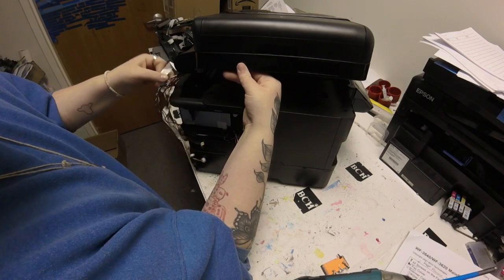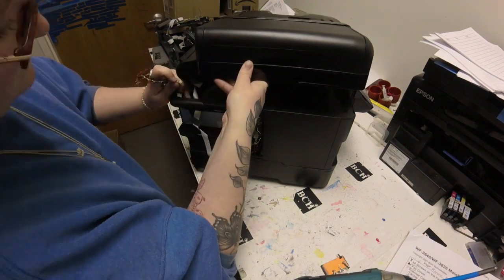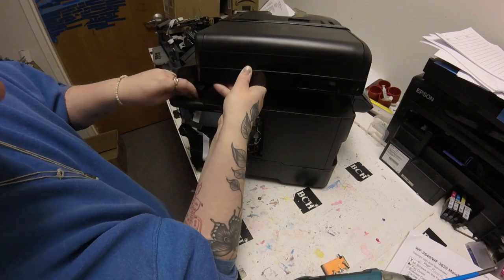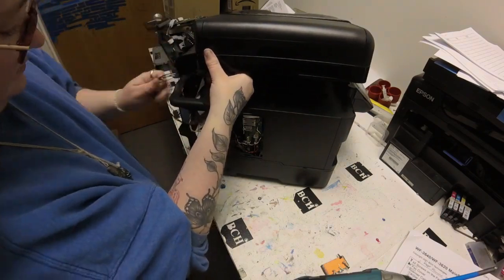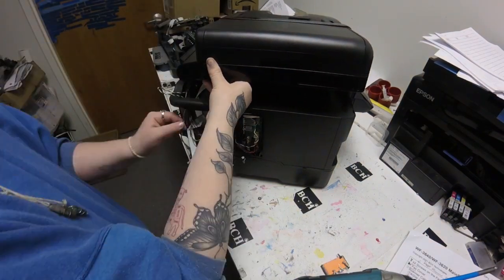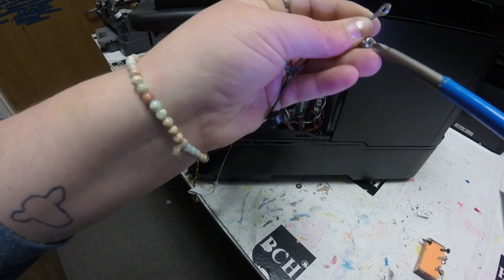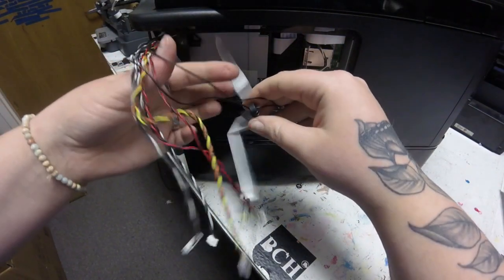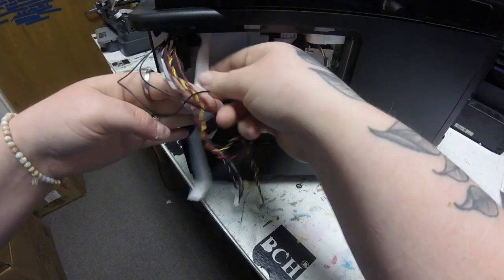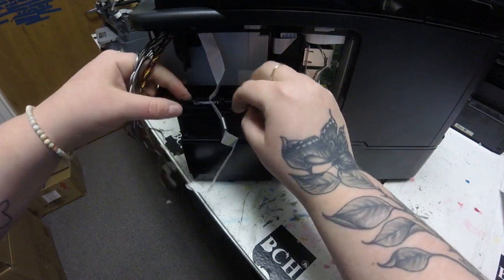Here I'm putting the scanner back on, and I'm going to feed the FFC cable and the wires through the divider hole in the back. I try to put the FFC cable on the front of the divider and the wires in the back — it just helps them sit nicer and stay divided for when we put that fax cover on. I've noticed it helps put the fax cover on a bit nicer. Here I am opening and closing the scanner to make sure it fits on nicely with that hinge. Getting ready to screw in the ground wire on top with the scanner wires — just trying to untangle and fit the wires and FFC cable in as nicely as possible. It'll give you a lot of trouble if you don't fit them in nicely.